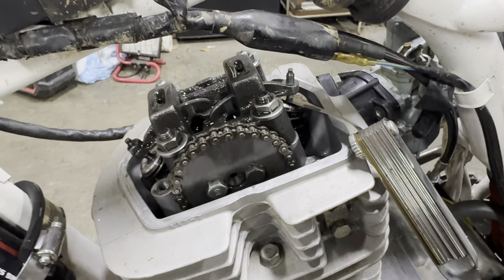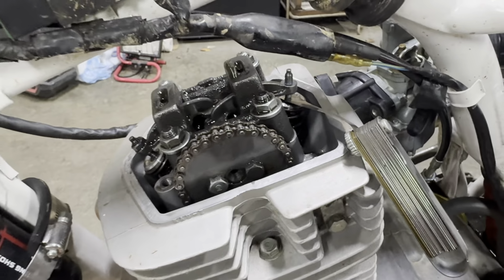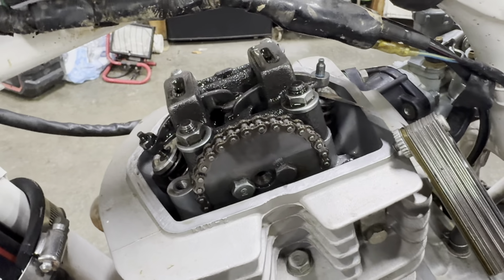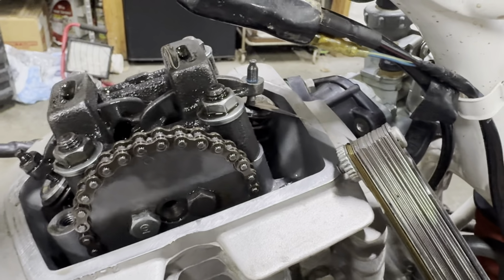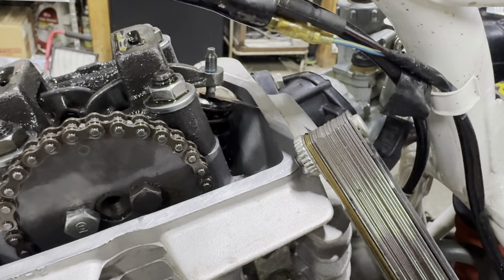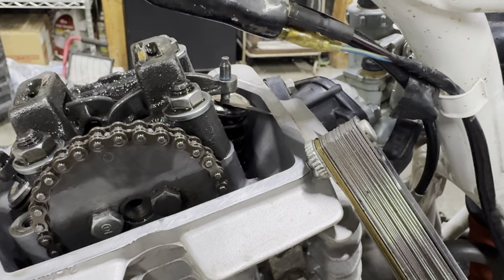And make sure you double check this, because sometimes when you go to tighten that nut down, even though you think you've held this good enough, it could snug up a little bit tighter, and then you'll obviously be out of the specs. So, like I said, 2 thousandths is the spec back here. Don't go tighter than 2 thousandths, but I would assume that anywhere between 2 and 3 thousandths is usually okay. You have a little wiggle room, but it shouldn't be too hard to get it to where we want, that 2 thousandths, which I'm going to show you, should be nice and snug in there.